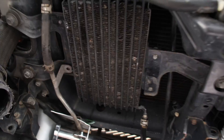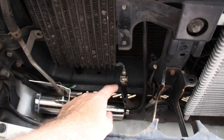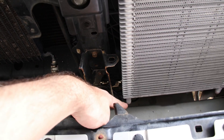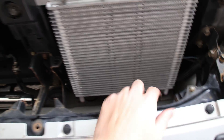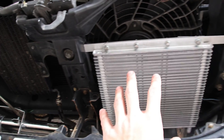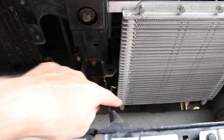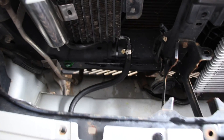Now we want to connect the old cooler up to the new one. That is in and that is out, so I'm going to attach that one and connect it up to that point. Then I'm going to use this long hose — it comes with clamps in the kit — making it go from there to there. In that way it cycles through the old cooler, then through this new one. The fan is behind it so when it's on it'll draw even more air through, and then it exits down there back to the gearbox.